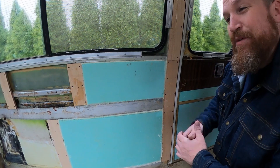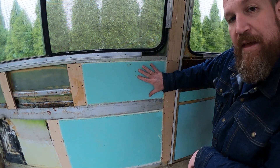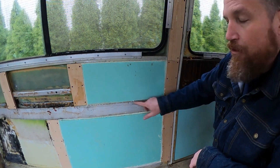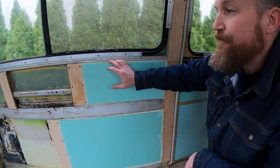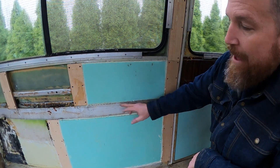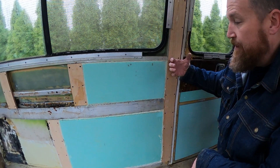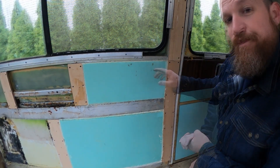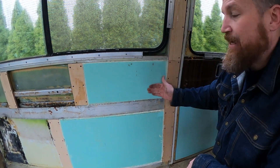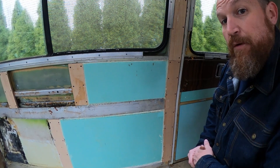Even banging on the outside of the coach, you can hear the difference. The foam pieces are made about a half inch shorter than the overall dimensions, so I have a quarter-inch gap all the way around. Once this is all glued and dry, I come back with spray foam and fill all the gaps and any voids that are behind the metal or behind the wood with the aluminum channels. It seals everything in there real nicely, and the foam has a solid uniform contact with the outside of the coach.